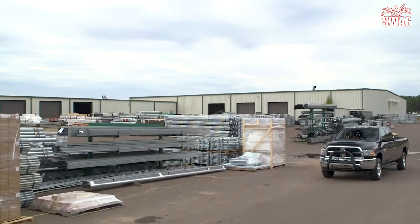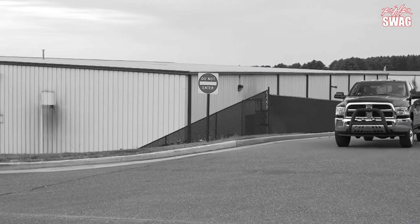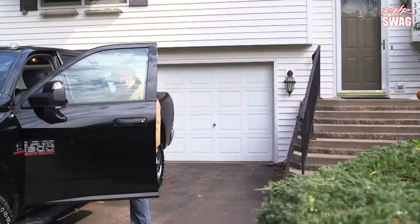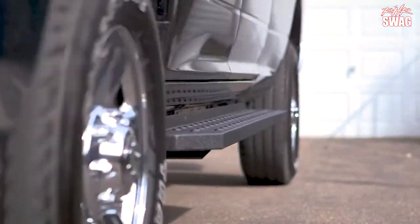It is important that you perform this acceleration in a straight line. BetterWeigh will disregard any data collected while the vehicle is turning. If you don't get a reading, stop and try again. Every time you repeat this process, BetterWeigh gathers more data and increases the accuracy of your reading.